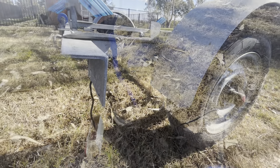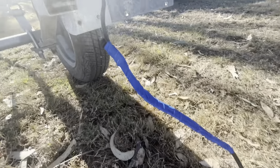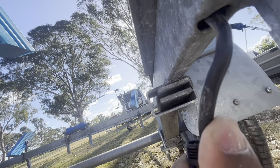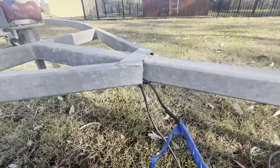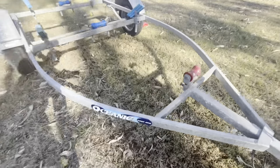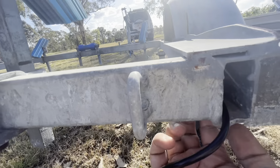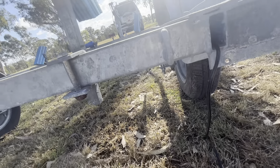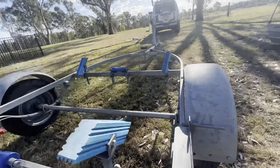Once you've taped the new wire to the old cable, make sure it's nice and straight with no kinks, bends, or knots, then feed it through the little hole in the chassis rail. What I found was it's actually a lot easier to pass the new cable directly through the larger opening rather than the tiny hole. You can then bring it down through the end hole as well. I'll repeat the same step on the other side.